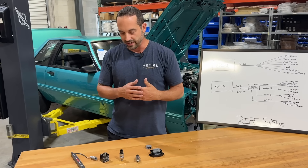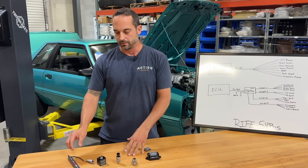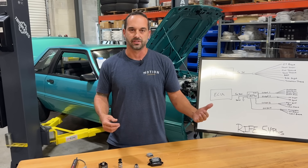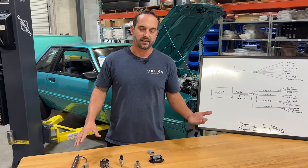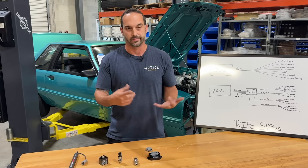Now, we're thinking about having our wheel and shock sensors basically hooked up to the same circuit as our crankshaft position sensor or MAP sensor — sensors that are crucial for your engine to run. If something happens along this circuit to bring that down, your vehicle is going to stop running. It could misfire and cause a lot of damage.